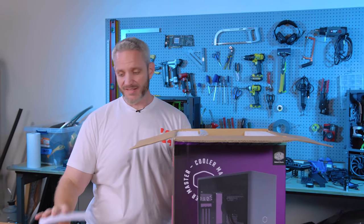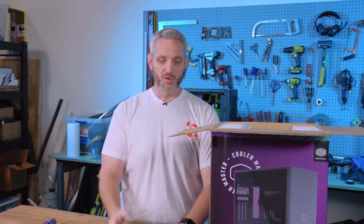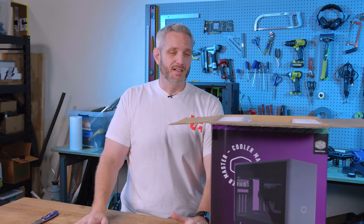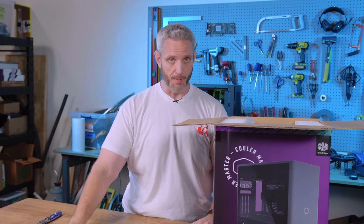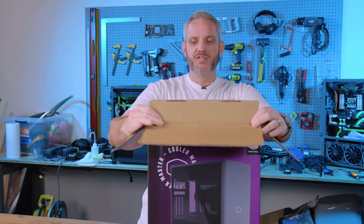So here's the deal — this is the Max. One of the major problems with the original NR200P is it had a side bracket where you could put two fans or a radiator, which would blow directly on your GPU that hung from the top in an inverted design. The problem is a lot of people ran their 240 AIOs with the radiator on the bottom and the pump above it — that is an absolute problem. You do not mount your radiator at the bottom with an AIO. They've addressed that in this one.